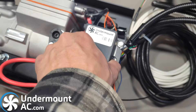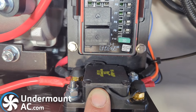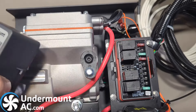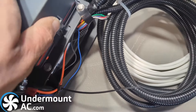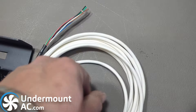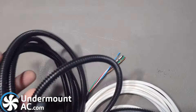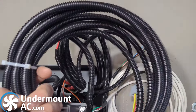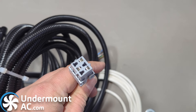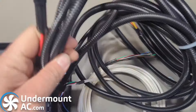The compressor assembly features a fully sealed Eaton relay center and a self-resetting Bussman high-amp 150-amp circuit breaker. All you really need to do to connect this entire assembly — outside of your refrigerant lines — is apply power and ground right here, positive from your battery right here. This white connector goes to your thermostat, and the wiring here corresponds to the wiring on the back of the thermostat. This single wire connector runs to the condenser and provides power to it; the ground on the condenser is fed from your chassis ground. This larger loom features a three-wire connector that feeds power to your evaporator. Our version 3 kits have 18 feet of wiring to the evaporator, 18 feet to the thermostat, and 10 feet to the condenser.